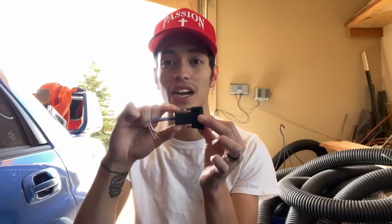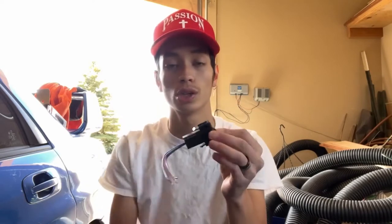With the button in, it's super sleek and looks like it's supposed to be there. One problem I have is this shaft here doesn't allow me to put the locking nut on to hold the button in place. For the white buttons we just have to cut off the shaft — I picked up a Dremel and we'll cut it off no problem. The orange LED ones have no shaft, which allows me to put the locking nut right on the back. So I'll do the orange ones first since they're easier, then tackle the whites.